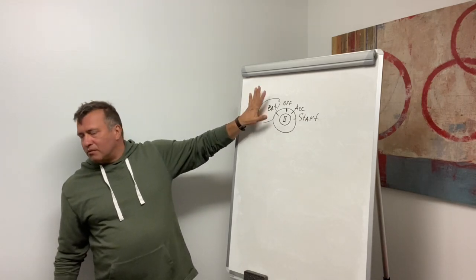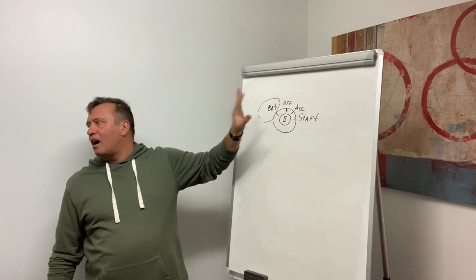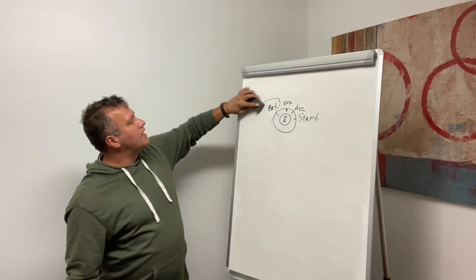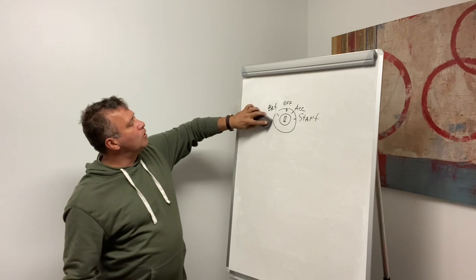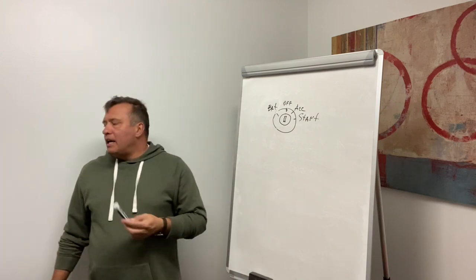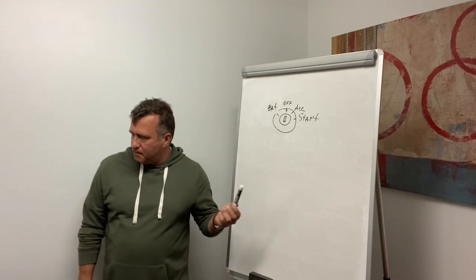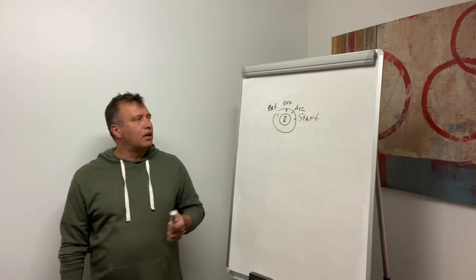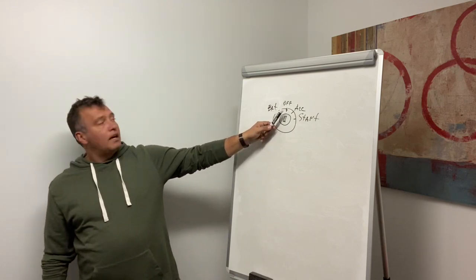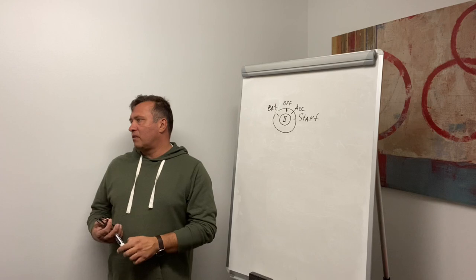I will explain when we finish up doing the external lights, I will explain how we do safe start, safe engine start. And this is very important as well, okay, to know how to do it properly. And I'll explain more. So, to make your headlights, high beams, turn signals work, what position do you need to put your key in? Accessory. If it's in off position, okay, you cannot fire that.